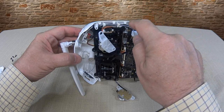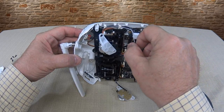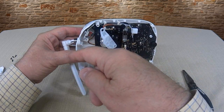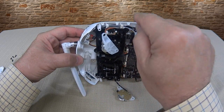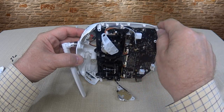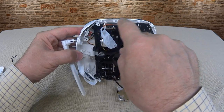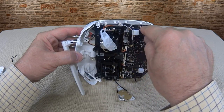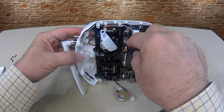And I'd mentioned before, these ribbon cables are very, very delicate. So what you'll do is pull this up gently and you'll break these two glue connections, and then the cable comes right out. When you're doing that, just again, be aware of the fact that these cables are extremely delicate and they're right near the cable you're pulling on. You might want to check when you're finished, and I'll do that in a later step, that these are fully seated into the two connectors. Again, the same type of connectors that held the printed circuit board we removed earlier.